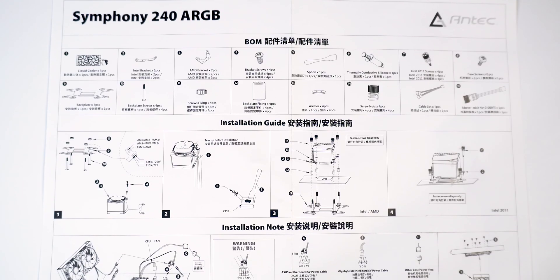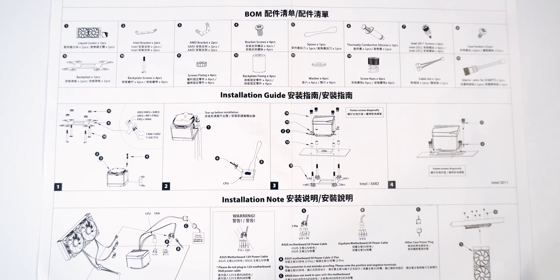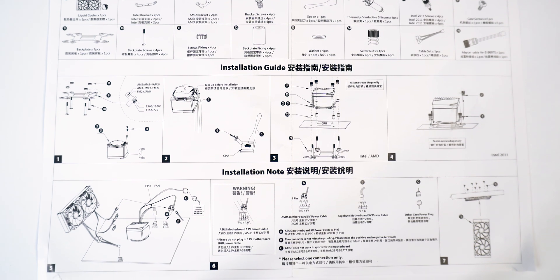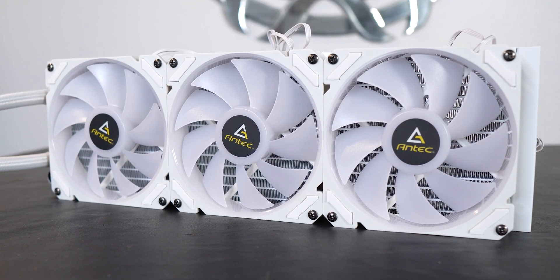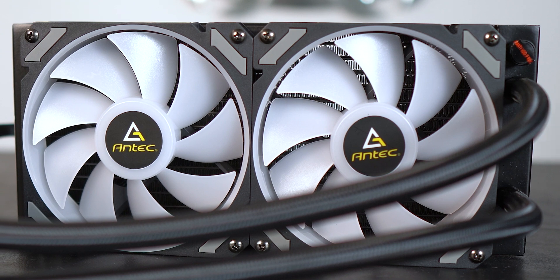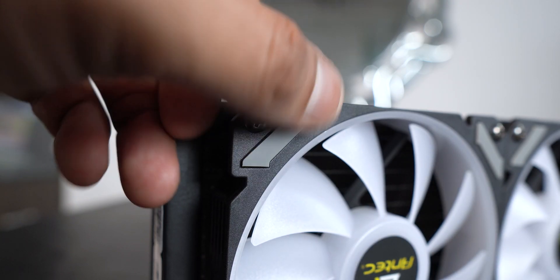The supplied manual is a one-page printout and the instructions will not be easy to decipher if you aren't someone who has been building PCs for a long time. The AIO fans are pre-installed on the radiator, which saves a decent amount of time if you are opting for the same orientation. You can remove and mount them on the other side if you want. The fan's stated air pressure is 2.1mm H2O, which is decent enough for static fans. They also have noise-damping rubber pads on the four corners.